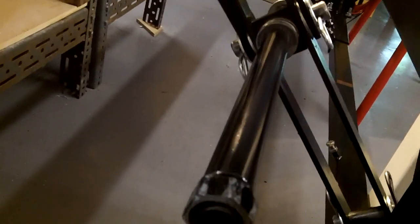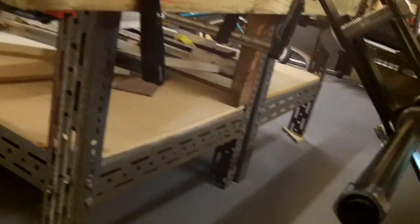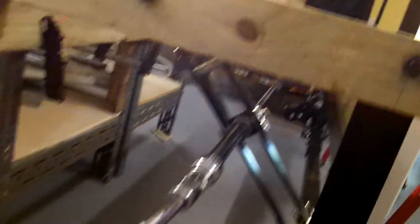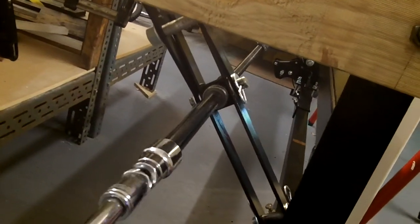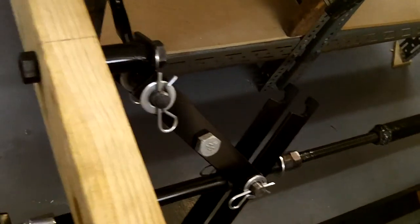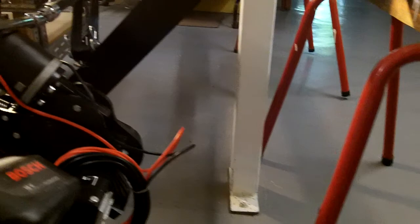On the end here is our wind-up nut. We will have a little bit of caravan poking above the chassis beams, which is why it's on an extended length. I'm just using a cordless drill attachment here to wind these up. As we wind, you'll notice the scissor setup is closing in and the motors are now lifting up and out of the way.